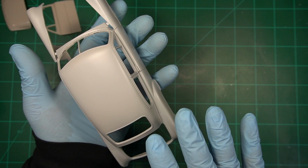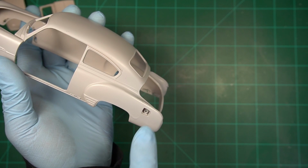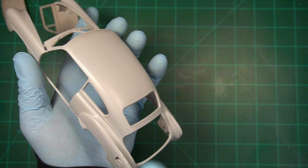And then we're gonna get to the painting of the rust here very shortly. I did make one mistake on the side that I'll show you here. I got a little overzealous and sprayed into the filler way too much, and you can see the drip marks there. I don't hide anything from you. All I'm gonna do is sand that down, and then we're gonna reprime it, get it all nice and spiffy, and we'll be back to painting.